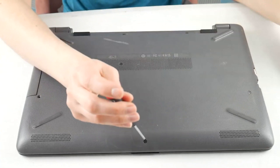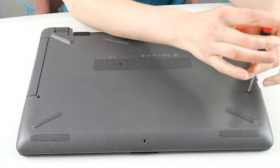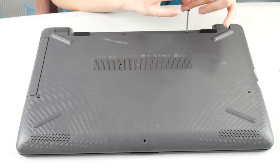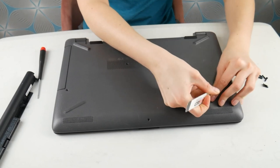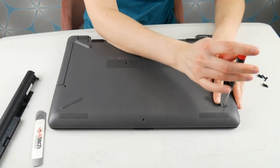First thing, we're going to take off the screws. Now, I know this seems like a lot of work, but your fan not working properly is a big deal because your fan keeps your motherboard and all those components inside your computer cool. Also, if you are concerned about a computer overheating in general, a cooling pad is never a bad idea. So I'm taking all the screws — in this particular model I have to remove the feet to take some of the screws off.